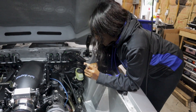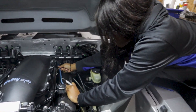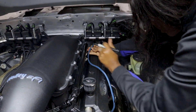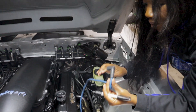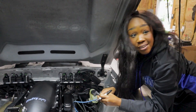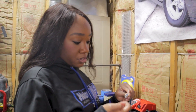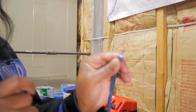Now we are just going to modify my plug wire. I am going to line it up basically how I want it, mark it, and then I have new ends for them so I am just going to crimp those on and repeat it for the next three smart coils. You can see kind of where the mark line is — we cut that off, stripped the end off, and it exposes the spark plug wire there like that.